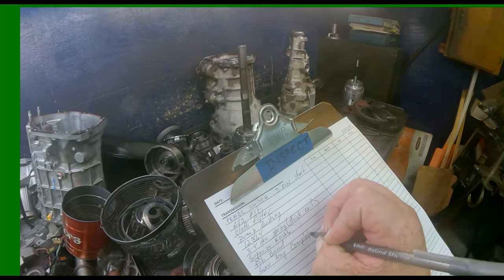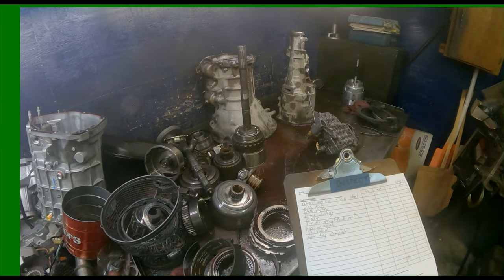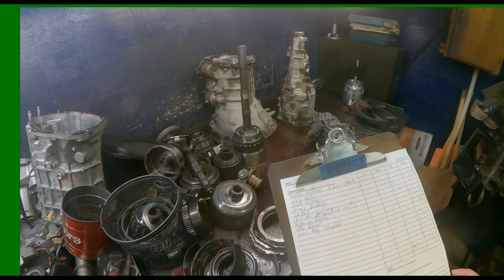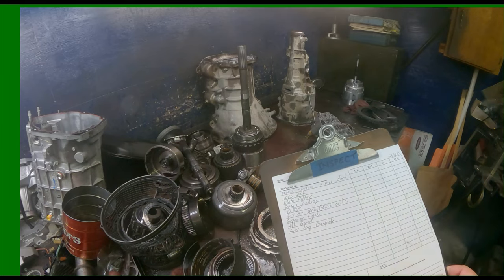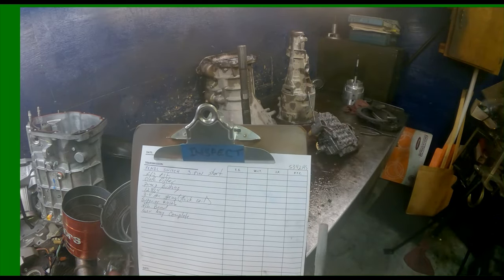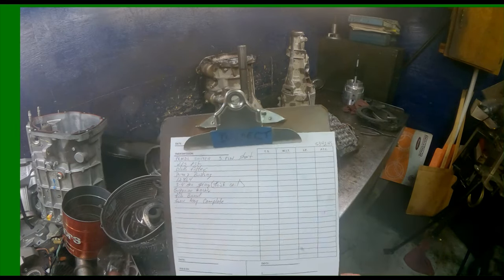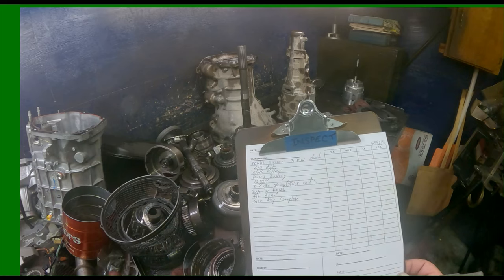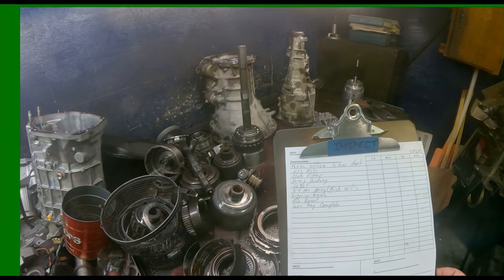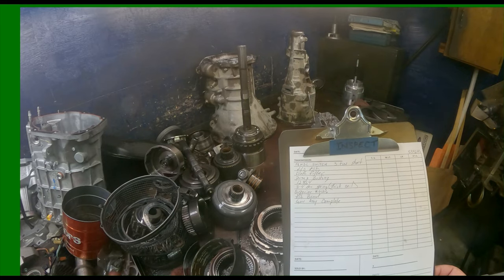I'm going to have to take this valve body apart also. If there's any valves in there that ended up needing to be replaced, I'll put that in the description. Somebody's already put a Precision converter in it. This one is a 5342HS, means high stall. So, I think that's it for this one. And we'll catch you on the rebuild.